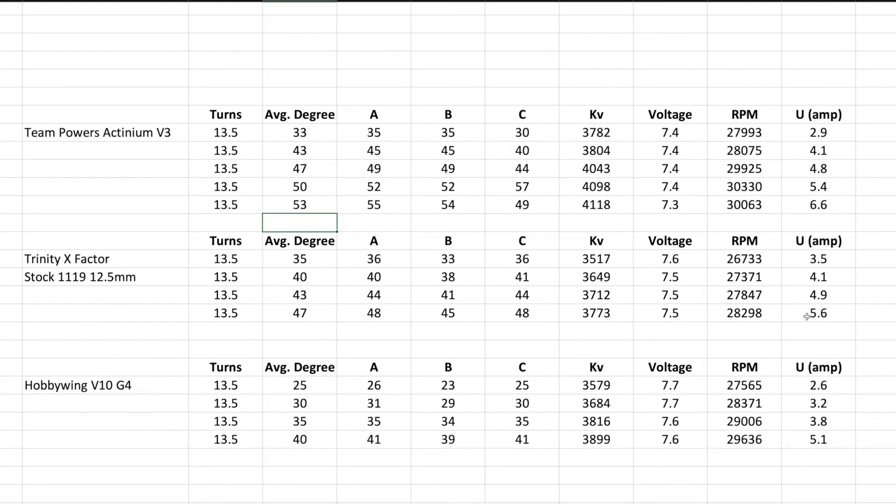A 4.9 amp reading would be a safer amperage. Comparing all three: 40 degrees timing, 47 degrees timing, 4,000 KV — and the HobbyWing is under 4,000 KV at 40 degrees. If you bump up the timing a bit it won't gain this many KVs, but the Trinity is a stronger motor than the Team Powers, and the HobbyWing is somewhere in between. The HobbyWing is going to be a high-revving motor by comparison, as you can see that correlation between high-revving and high-torque rotors.